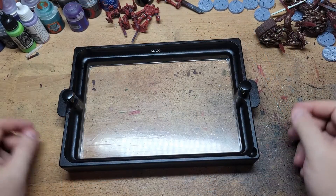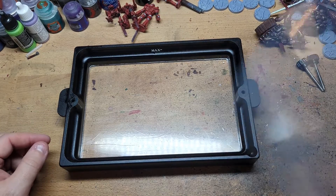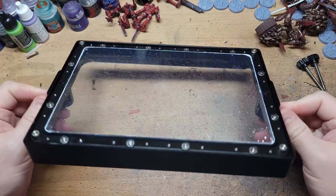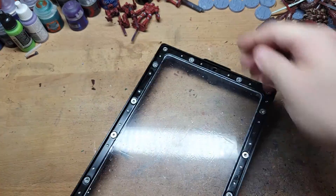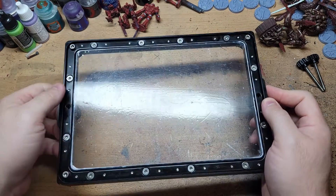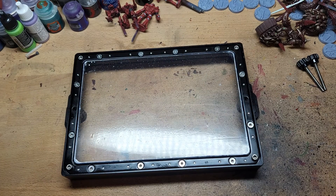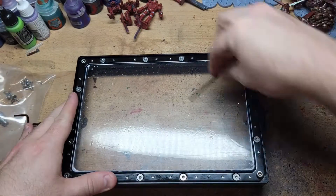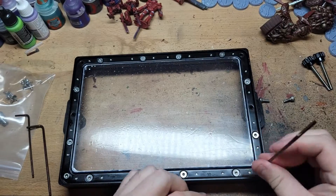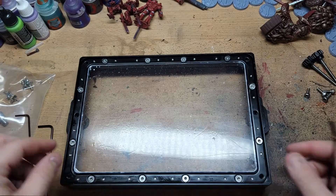As you can notice in that picture, there was a little bit of resin that somehow made it through the FEP. I had done so many prints that it just wasn't surprising — you can see it's been pretty beaten up. So it was time to replace the FEP sheet. I'll film it for your information, in case you need to tackle that or are concerned about the process, or if you're afraid to dive into resin printing because you've heard horror stories about replacing the FEP.